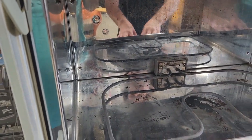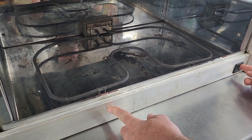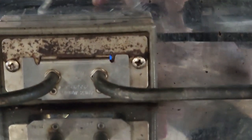Okay, the easy way to remove the drawer, if you don't feel comfortable pushing on it, is to remove this panel. It has your outlet in it. There are three screws. They're kind of hard to see. One is right here. I'll let my cameraman zoom in. The second is right here in the middle. Kind of hard to see the reflection. And then the third is right over here in the same corner as the other one.